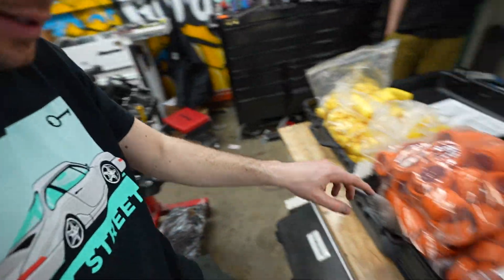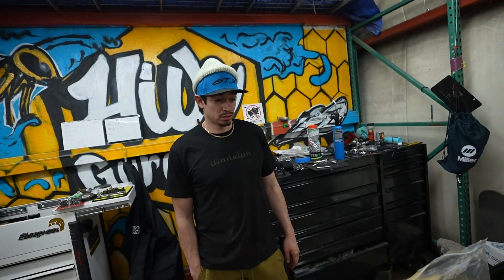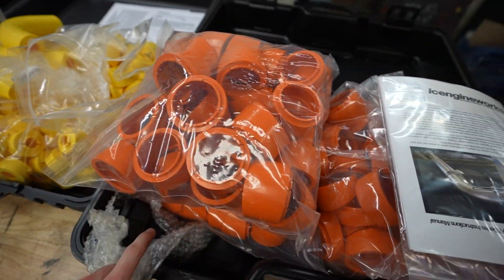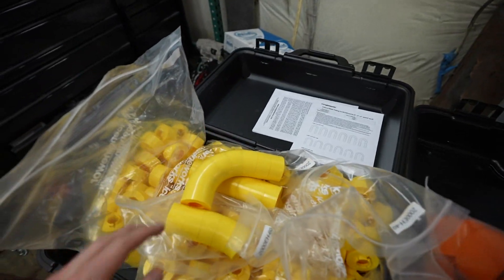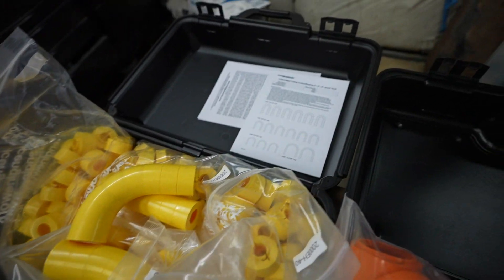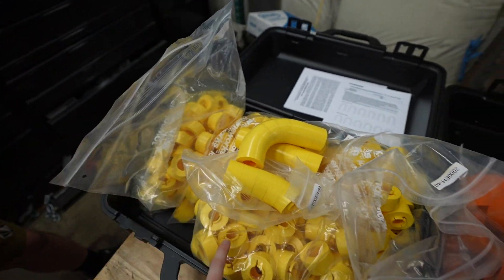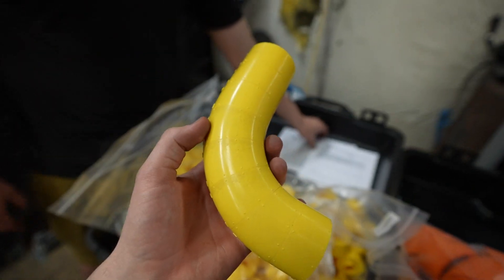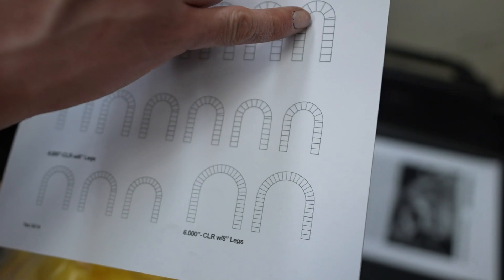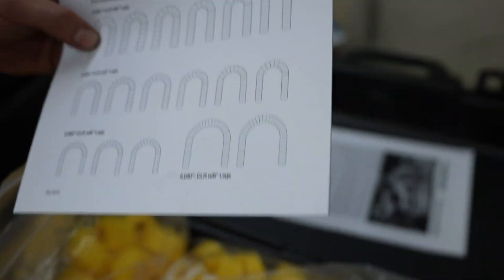It's tomorrow and we've got our sets out. We have three sets of these lego kits at around $1,500 a piece — about $4,500 total. Each piece is a different angle. The CLR — central line radius — is the key difference: a really tight corner versus wider and even wider. So you have an eight-inch, six-inch, and four-inch CLR, plus straight pieces.